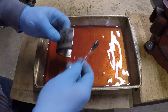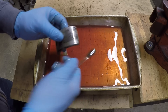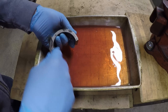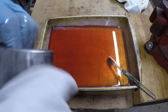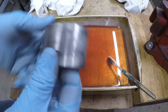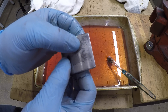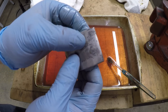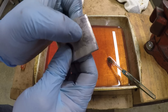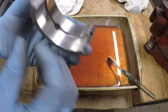Another thing I like about diesel is it's not going to wipe off any of the numbers on here. I'm curious what some of these date codes are — it'll be interesting to go through those and make note of when they were made. I'm just finishing with this first bearing shell and I've already found something rather interesting. The part number up top is 1F4314, and the date code is CUNRM, which using Caterpillar's numeral code translates to 10-30-42 — so October 30th, 1942, is when this bearing was made.